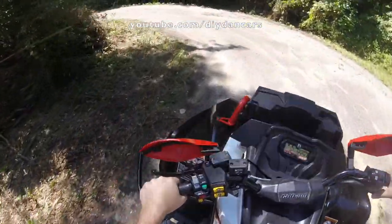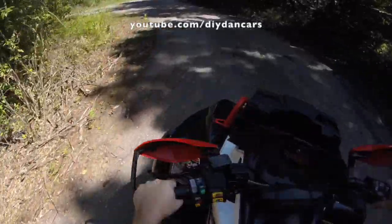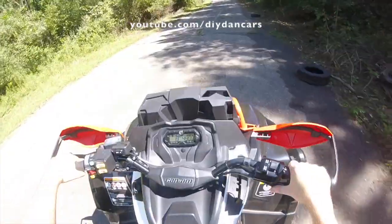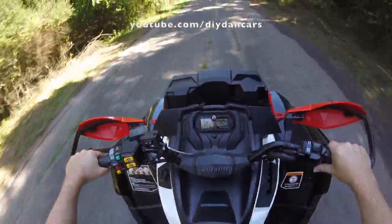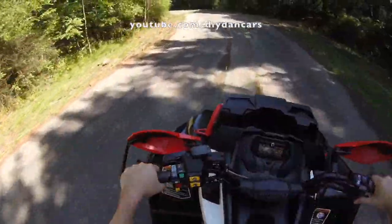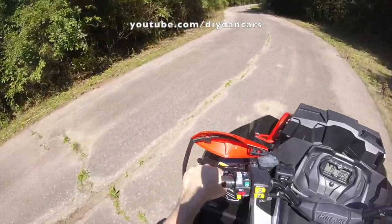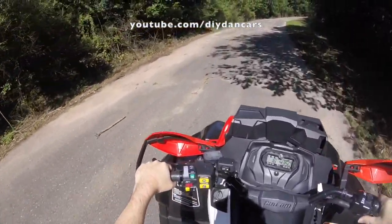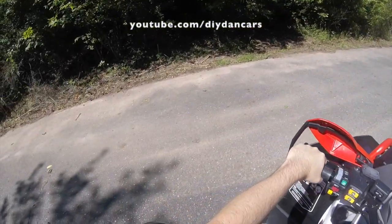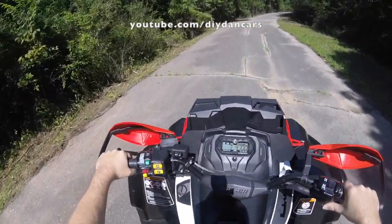The next disappointment is the cover to the airbox. This machine came with a factory snorkel, but the airbox cover lid — located about 8 inches below that snorkel — isn't watertight. I hear this is still a problem that Can-Am has yet to address; even 2021 models still have this design flaw. I personally never had the nerve to take my shiny new and very expensive quad swamping, but if you're one of those people, make sure you purchase one of the aftermarket solutions that will rectify this problem — otherwise, you better keep a spare engine on the shelf.